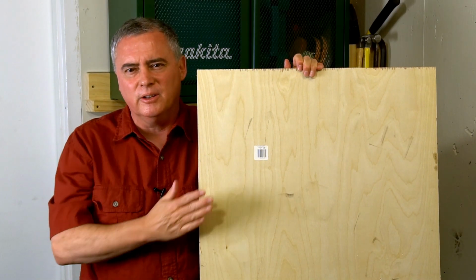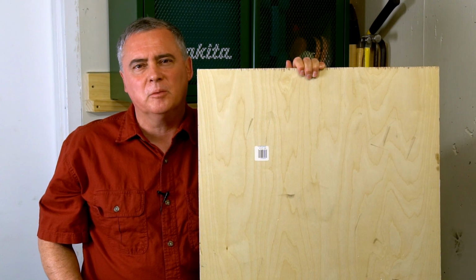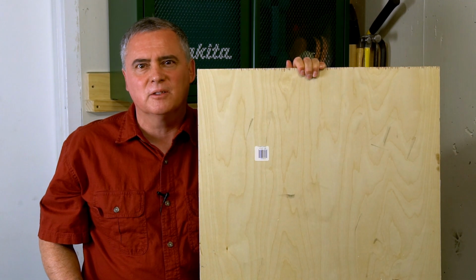You could also use a piece of plywood. Jack stands are also an issue when you have a soft surface like gravel or asphalt, especially asphalt when it's warm outside and it's fresh asphalt, because the jack stands tend to sink in, and that's terrible. If you have your car up, you don't want anything sinking in and potentially tipping over. So putting a piece of plywood under the jack stand is a good idea. The home stores in my area sell these 2x2 plywood sheets, and if you cut these into fourths, you'll have the perfect plywood platform to put your jack stands on.